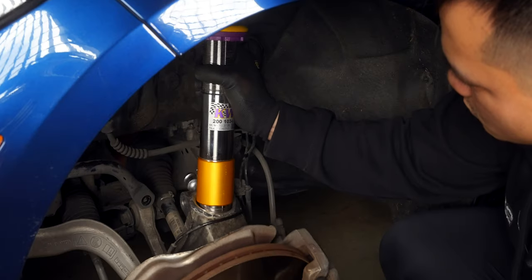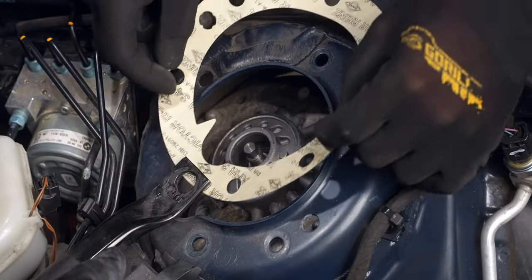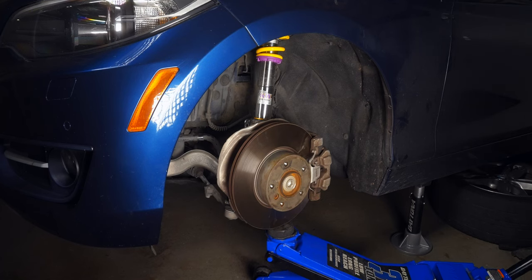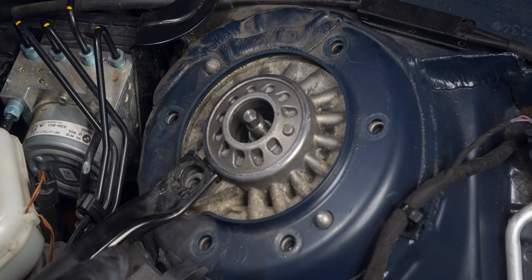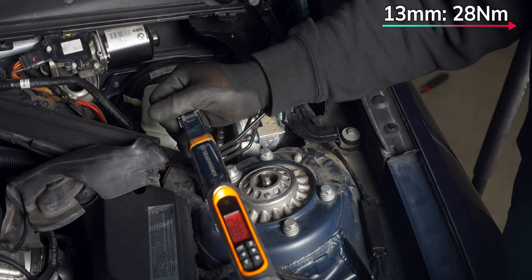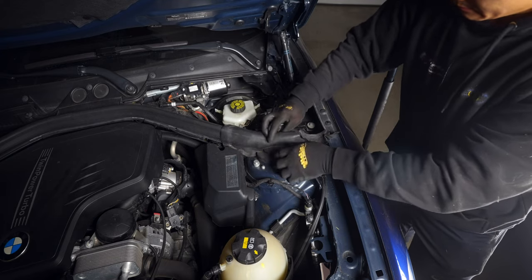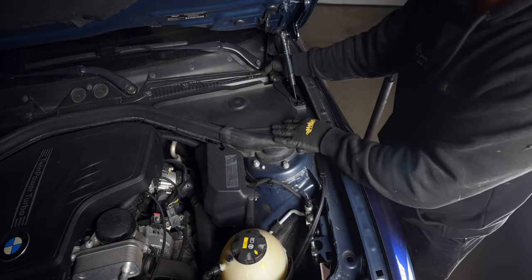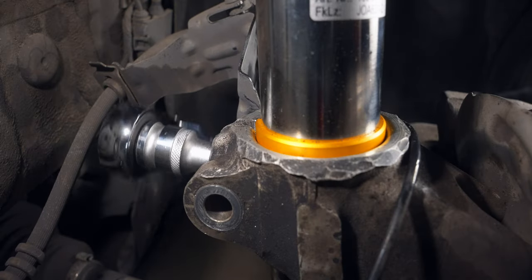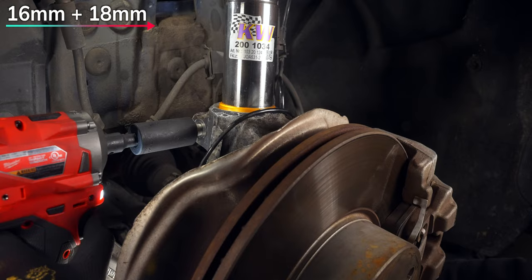Which turned out to be a good thing because the money saved by not going to a more expensive setup was used to upgrade the thrust arms that were found to be defective during the install. I can honestly say that after doing all the suspension modifications on the M235i, I wish I started with coilovers versus doing them last. Yes, they are the most expensive, but you truly get what you pay for. I would say that the next two suspension priorities after coilovers would have to be the thrust arm and lower control arm. And if you want the tension strut and traction arm in the rear, this will help with bump steer and dial in your fitment in the front. If you go with adjustable arms and mono balls in the rear, this will hold the alignment longer and be more resistant to deflections from road imperfections.